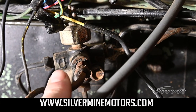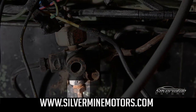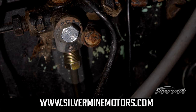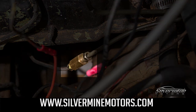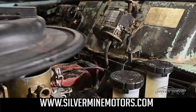Unscrew the rear brake line from the connection and unscrew the brake supply line from the bottom of the connector. We have plugged the hole where the rear brakes used to go and ran a new line to the master cylinder to operate the front brakes. We cut off about six inches of the old rear brake line, installed a union, and ran a new line to the master cylinder.